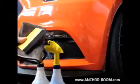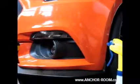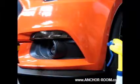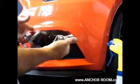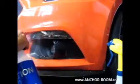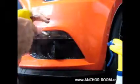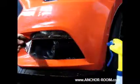It's a very straightforward installation because there are no difficult curves or angles in this case. We just peel the actual material from the backing paper, take the application fluid, and after having cleaned the lens, spray liberally — do so also on the back side and front side of the tint.